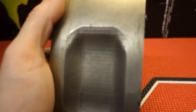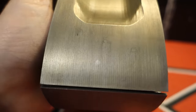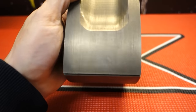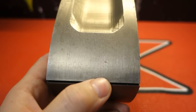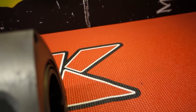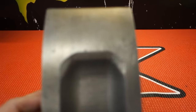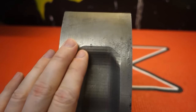Okay guys, I got this rotor all cleaned up. I would definitely say Evapo-Rust works — it got this thing pretty clean. I wiped it down; it kind of had some dirt and crud on it from the solvent I guess. This thing's in pretty good shape, but it has some damage on this side right here. I can see that one little nick. This is why I make a bad engine builder — to me I wouldn't want to use this rotor, even though the damage is not that bad. The camera won't focus — geez.